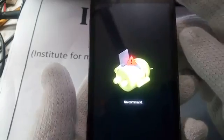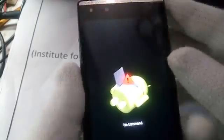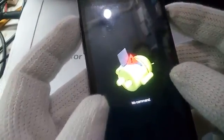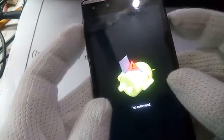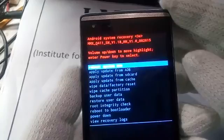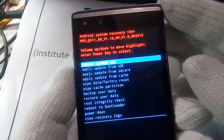This is the Android little man logo. Now press volume up and power key together to obtain a new menu. Now you can see the Android system recovery menu. Press wipe data.